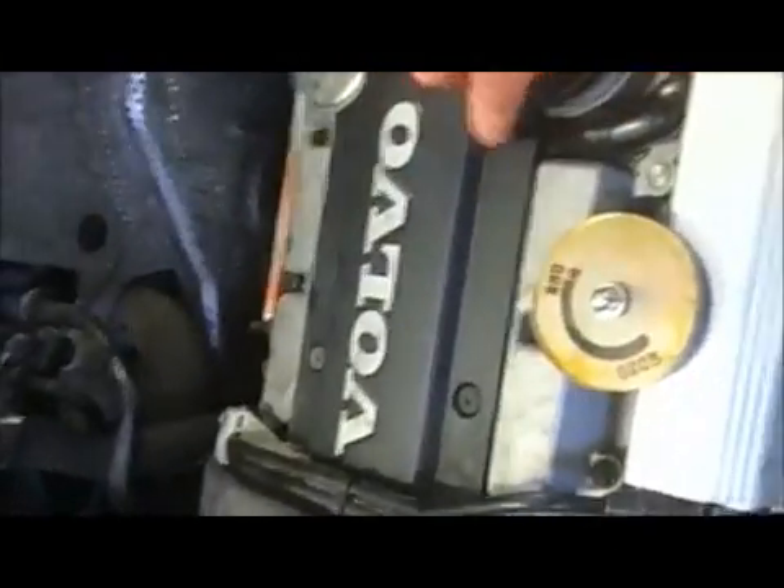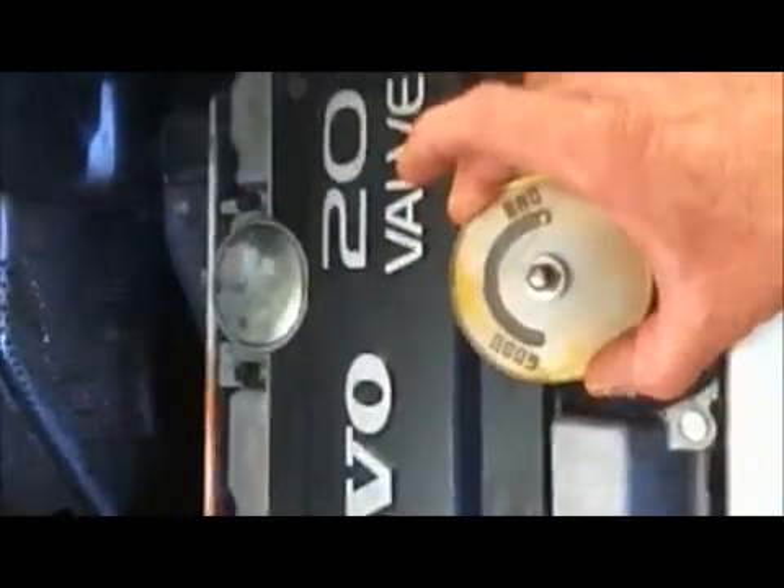Okay, this car here — I don't think it's gonna have very good pressure, let's see. Yeah, that's in the bad already, and that's just at idle. Go ahead and give it some boost. See the ball? The ball stayed in the bad. It's got high crankcase pressure — that's what we're looking at.